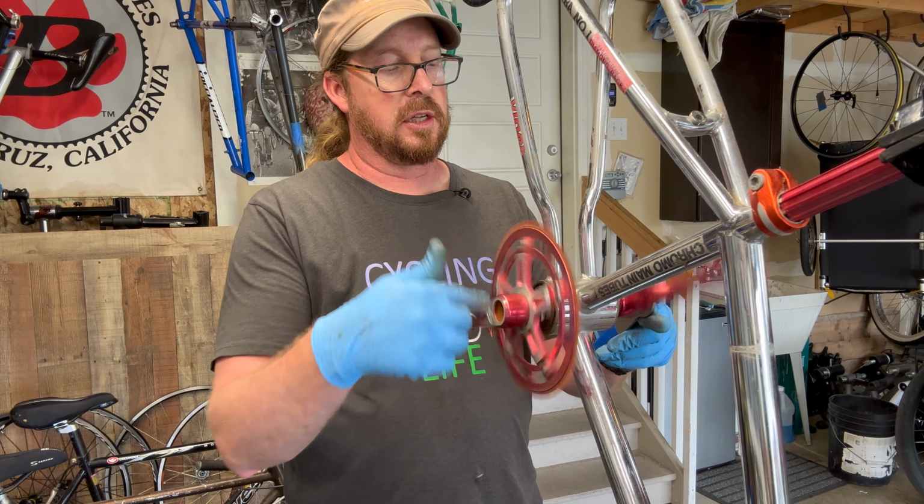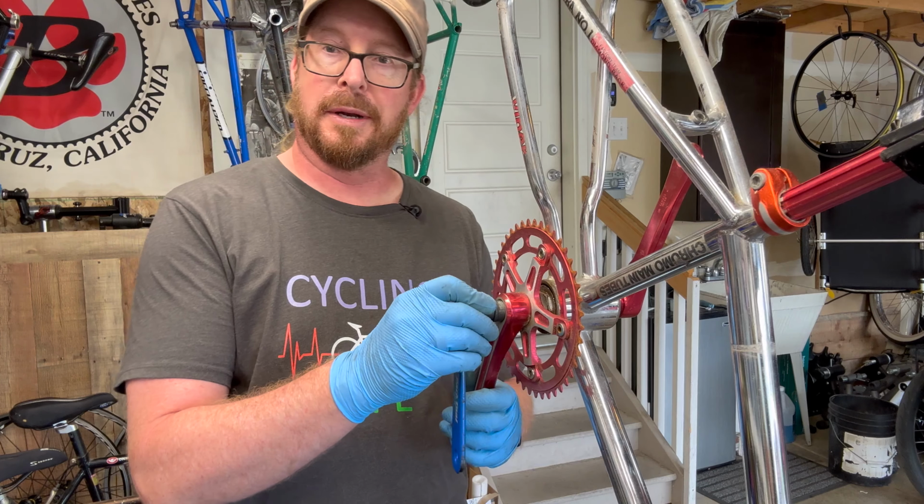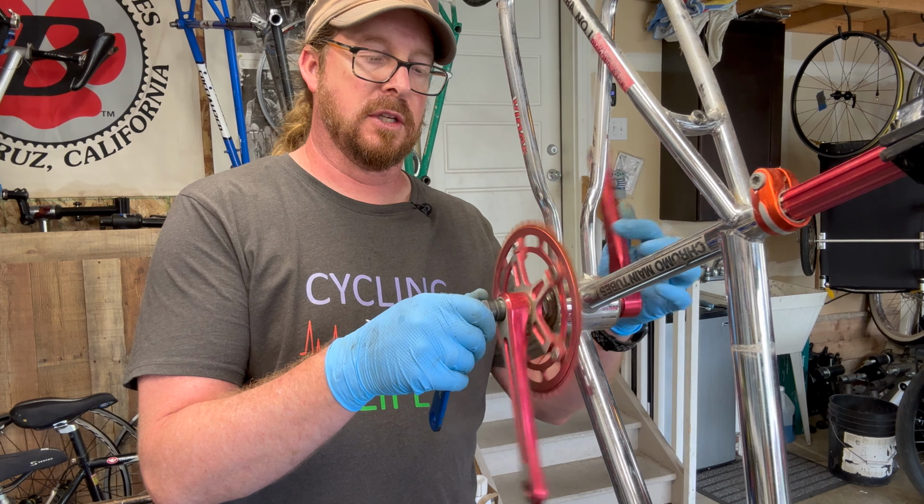For these, your typical crank arm removal tool, which is the push pin design, blow out all the remnant rust. Crazy. So I want to make sure I don't cross thread this. This goes in pretty good. And make sure it's flush all the way down. Reason being, when this pin engages, I don't want to strip any of the threads on the actual crank. And man, that is not on there tight whatsoever. So you guys see the little scary fuzz in there? Crazy, crazy. Alright, so we'll be cleaning those.